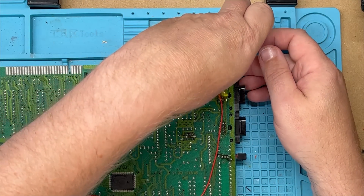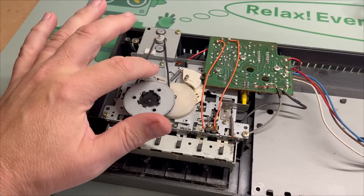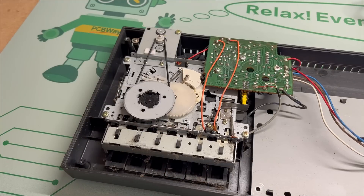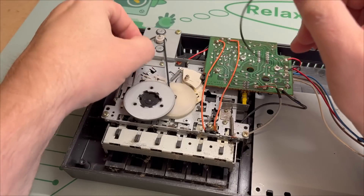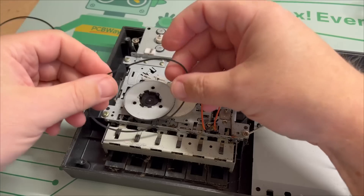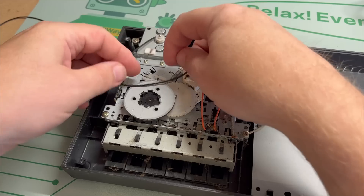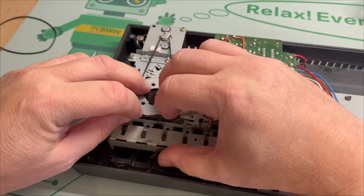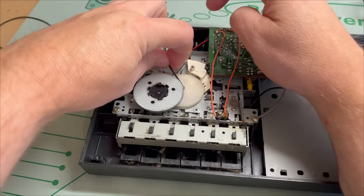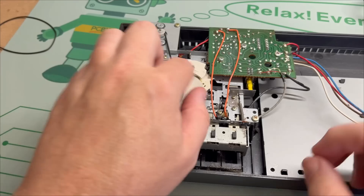We don't want to neglect the internal drive, so let's replace the rubber drive belt. As you can see, this one has developed a kink from being stored in the same place for years on end, and it is also likely to have lost its elasticity. If you're doing this yourself, it's important to get the absolute right size belt for the Plus 2A, as the Plus 2 had a two belt system and they were different sizes. Put the wrong belt on and it could be too tight and end up wearing out the bearings in the drive. With the new belt installed, let's put the old girl back together and see if she's all working now.